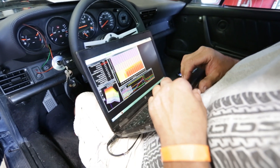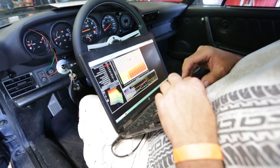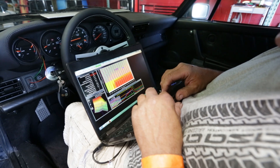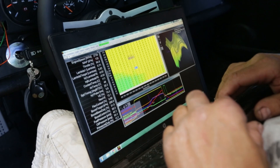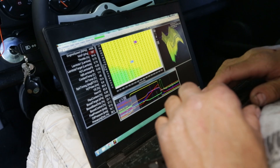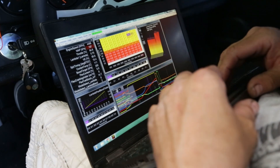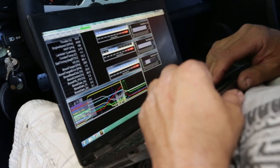So your process is you look at the log — what you see down below — from the previous run and you analyze it. The nice thing about this is you can scan through it and see exactly where you were in the tables along the way. I put all my critical stuff in here — I can see what fuel pressure was, oil pressure, everything that happened during that pull. Anything that's open in these windows I get to see: any crank sensor issues, flex fuel data, all our boost feedback data. Everything's live and logged, and because of how fast the processor is it's really nice to see all of this.